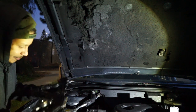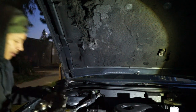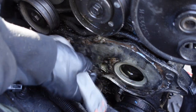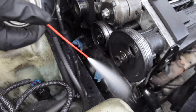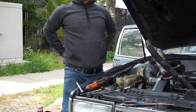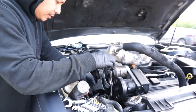The gasket looks completely worn and all the bolts were completely loose too. Use a plastic razor blade and scrape off the old gasket that's on the block, then use some towels and brake cleaner to clean the surface well.